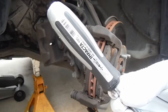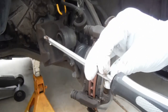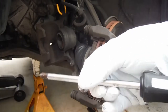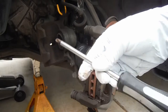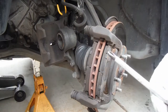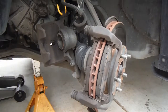I was going to show my new tool here — it's an impact driver made in Japan, it's a Vessel. You just put this in and strike the back of it with a hammer; it turns a few degrees counterclockwise to help loosen those screws. The size you need is the P3 — these are Japanese industry standard (JIS) screws, they're not Phillips even though they look like it. So if you do have the screws there, this tool is really helpful for removing them.